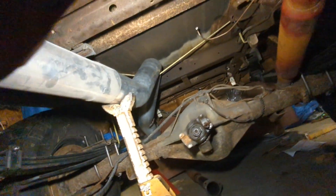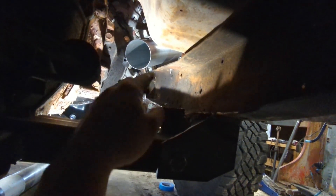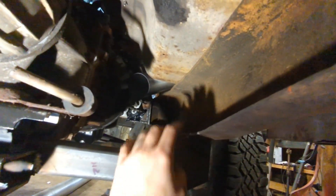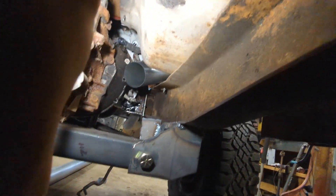Tailpipe is up in there and it fits pretty darn well. It kind of clears around everything — it's a little low in the back but I think we can pull it up. Up front we've got the trans crossmember right here, the downpipe up there, and it's going to need to snake through. I think a couple of bends there — I want to keep it kind of low here, away from the floor, so it doesn't put extra heat into the cab. The 51 gives you heat in the winter, but this thing actually has functioning heat so I don't want to add all that extra heat. We'll snake it down through here, might have to take off this old exhaust hanger, then connect it to the back.